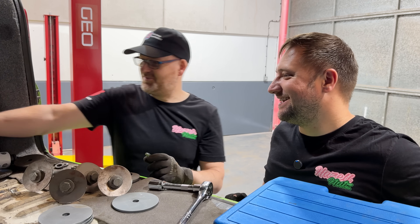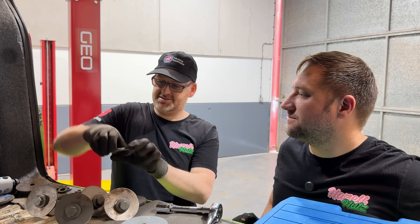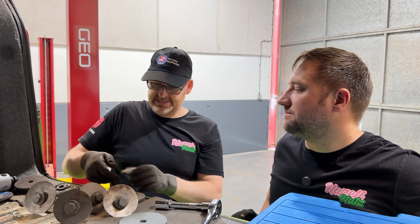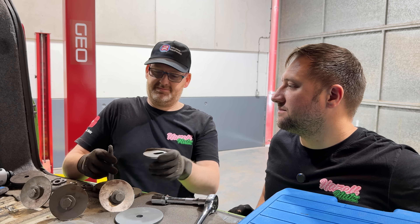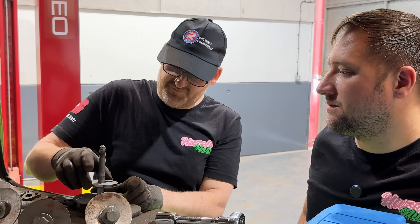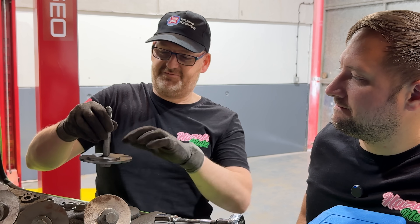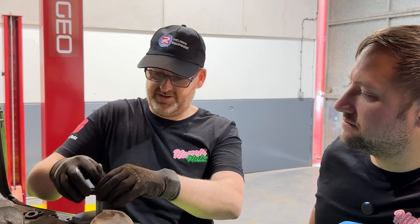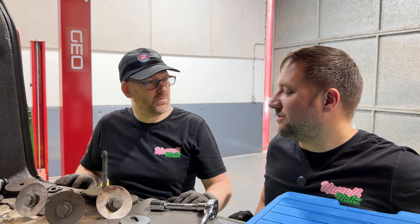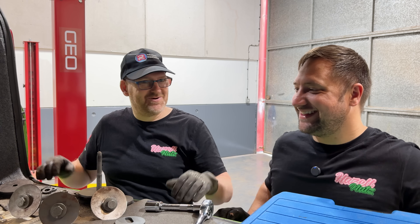It was then time to get the subframe back out due to our oopsie and start fitting Carl's new solution. We're going to cut the bottom out of the subframe so we've got the holes in the bottom, then this sits in the top — it's got a slot in it so that allows it to rotate in any direction we want. The bolt can come through a big back washer, the slot goes on it, and it can move around in whatever direction we want. When it's all finally in position, we can tack it up and weld it properly — probably should get it all aligned first and then weld it up.